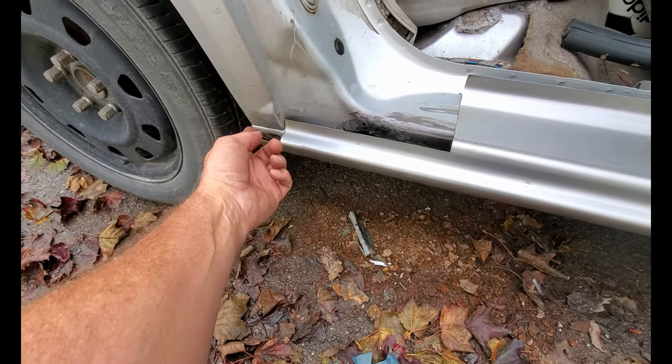I took a couple of chops out of there to get it this far. This area with the flange comes all the way up to the pinch welds underneath the door seal — that's pretty much right in the center. You can see this one's pretty much in the center as well. I said about chopping this off here, but you know what, I think I'm going to leave that and work off this radius if I can, because that'll be a nice easy way to clean up.